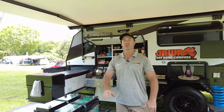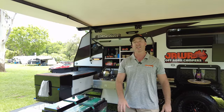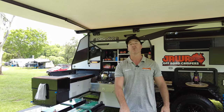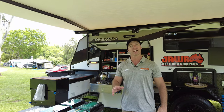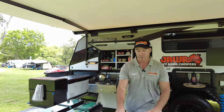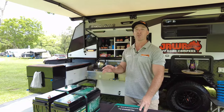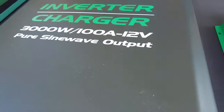If you've got a smaller system, which a lot of other manufacturers use — say a 30-amp — four hours of that, you're only going to get 120 amps. This is working at a much higher rate, almost four times as much. And in a lot of spots, you can't run a generator in National Parks for longer than a certain period of time. So the big advantage here is the 3,000 watts you can use in the power points off-grid, and then that 100 amps to get those batteries fully charged.